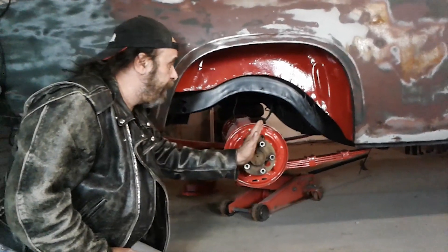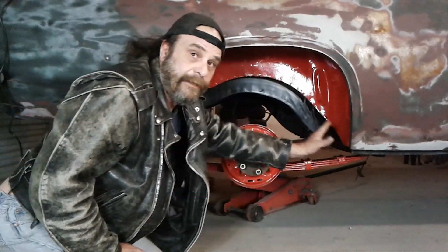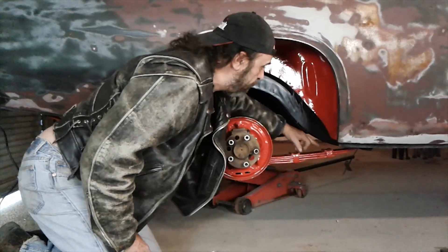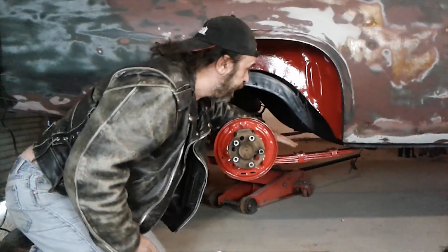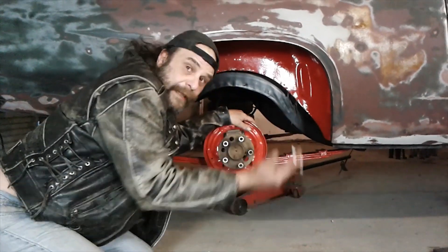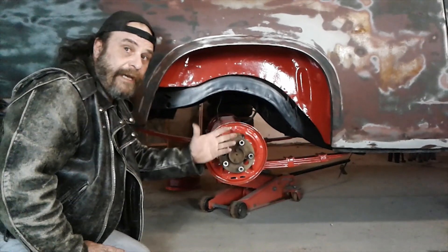Chryslers have their locating pins approximately a third of the way to the front instead of half, so this front section is much shorter. On high-performance cars, they actually added extra half-leaves on this side for that exact purpose. So for drag racing, it's perfect.